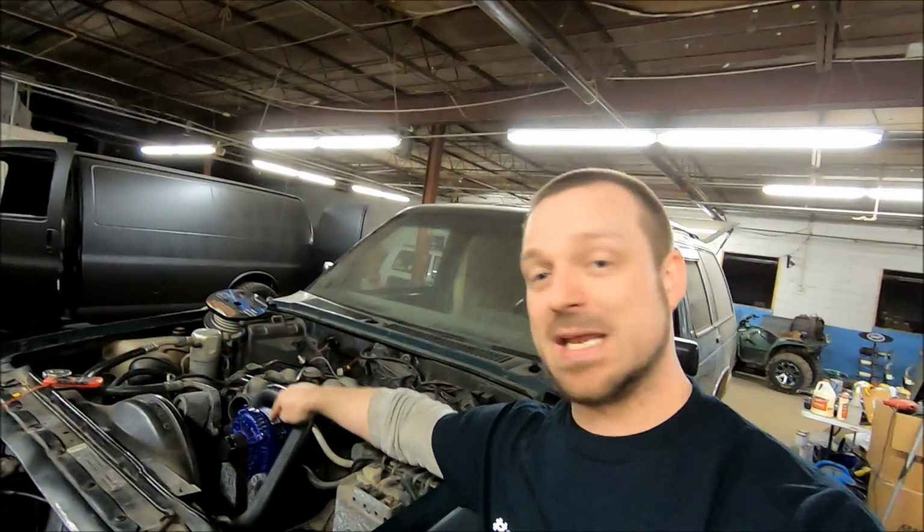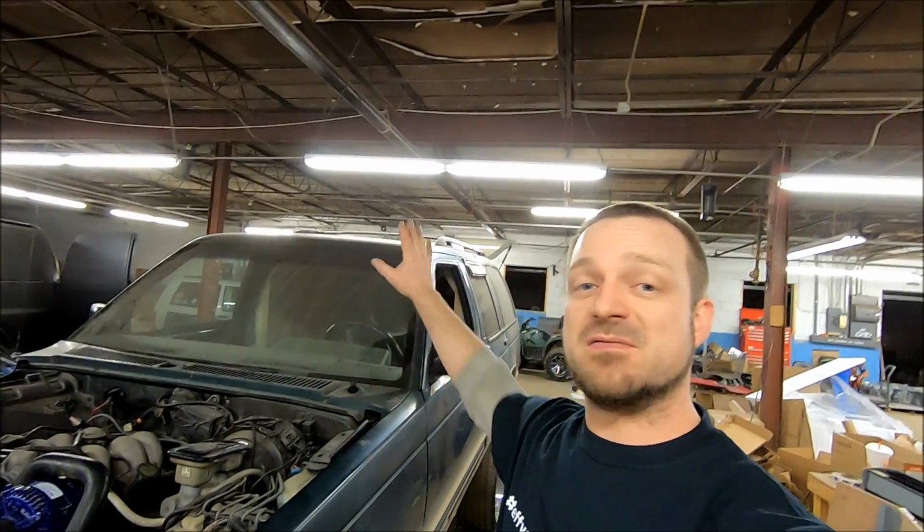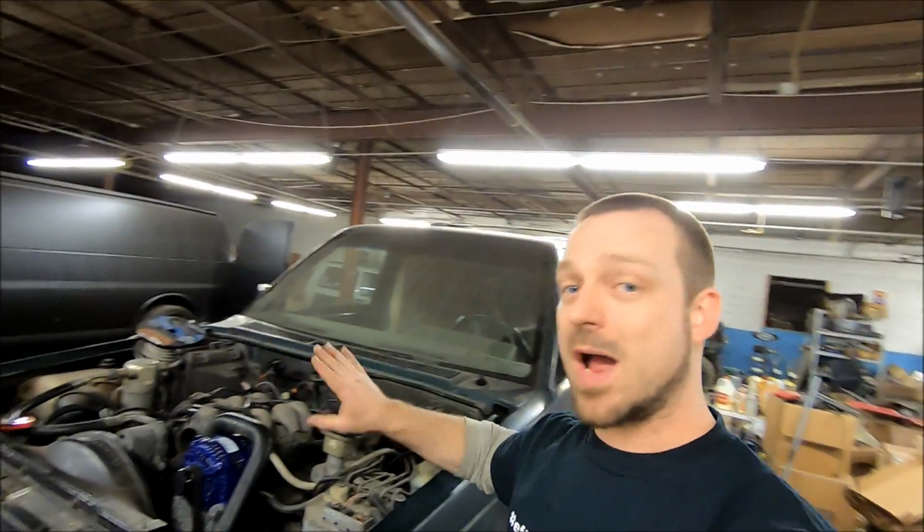I say, for me, even if you have a huge, massive setup, you only need enough runs of wire to get the power from here to back there. You're not feeding all 50,000 watts of your power from up here. You don't need enough wire to carry that. That's just not how it works. So feel free, do the math yourself on your setup, how much alternator power you've got that you need to move to the back and how many runs of wire it's going to take.